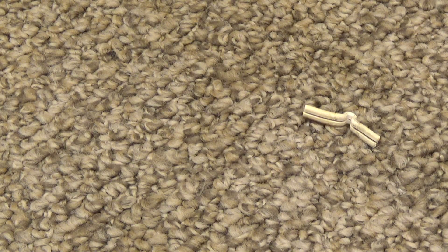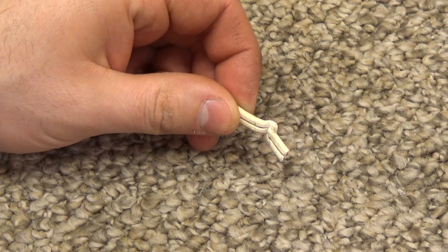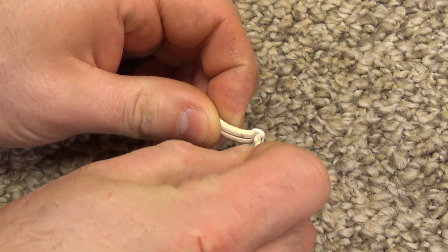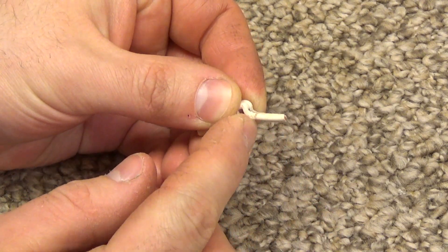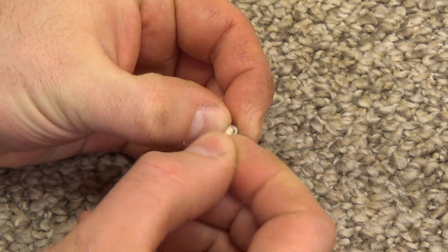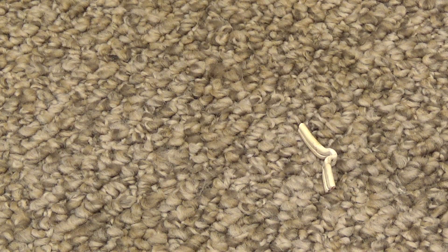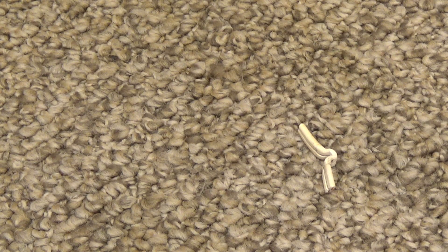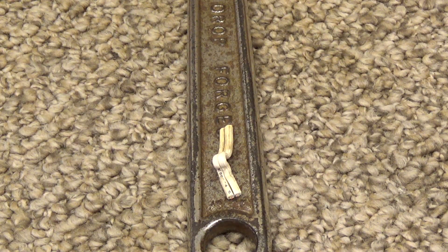This is the piece of wire from the Galaxy box fan that was working intermittently. I want to try to cut this open and see if we can visualize what the failure is. It kind of feels a little bit flimsy right where that little line is. It's stranded wire, so I'm very surprised that it just cleanly broke, but I suppose all those little individual strands will eventually break if they're flexed enough times. I'm going to try to just cut it open with a razor.